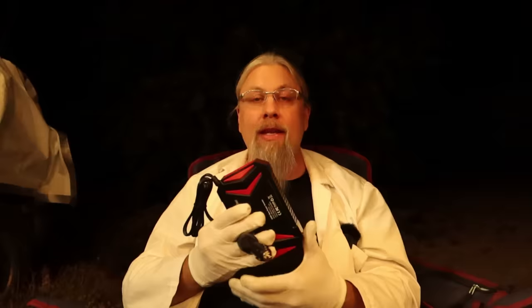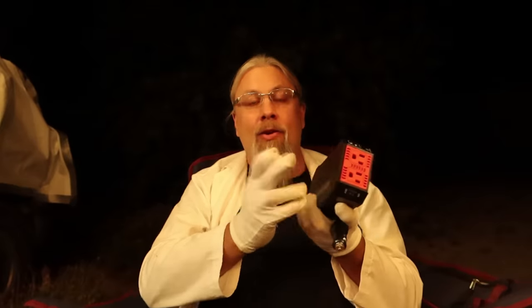This is something I've been looking for for quite a while. One of the biggest problems in the industry with portable power stations is that a lot of the big ones can't be charged from 12 volts. They have to be charged from solar, from 120V, or use some special adapter or high voltage. This is the solution. You can plug this into your car, truck, van, or RV — either your main ignition power or your house power — get 110V AC, use the AC power adapter that comes with your power station, and charge it at its full speed. I'm going to prove to you that it can be done.